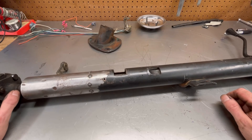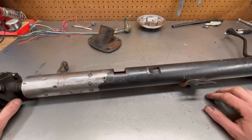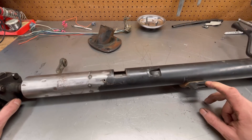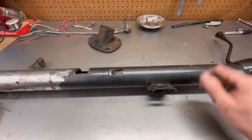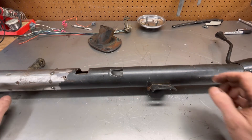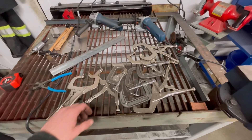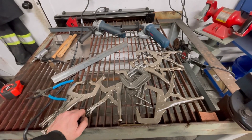In the next video we'll get this all finished up — finish weld it, sand it, and paint it. I just want to mock it up first and make sure everything fits, then we'll get the rubber boot on, get all the wiring back in, and figure out what to do with the broken tab. All in all, this didn't take too terribly long. The disassembly took a bit of time, but you could easily knock this out in an afternoon if you're a fairly confident welder and mechanically inclined. Just take everything apart in order, start with a clean bench so you don't lose bits, and take pictures if you need to remember how it goes back together. Worst case you can pick up these columns at any junkyard. Pretty happy with how this one turned out — trying to keep as much original stuff in this truck as possible. Thanks for watching, we'll see you next time.